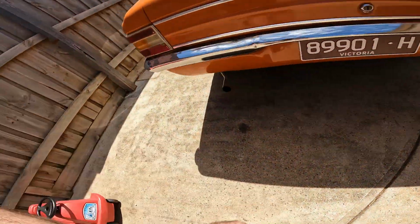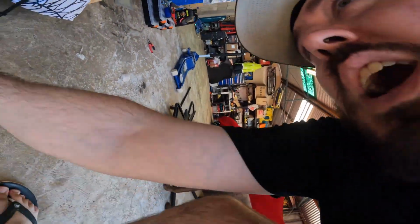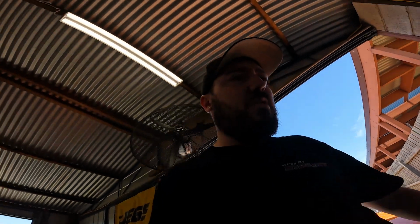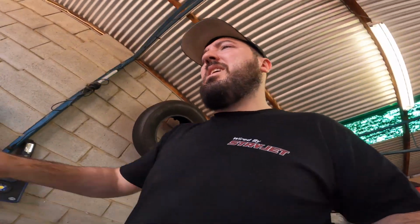What's that? Actually, that knock may cause an issue. I'm gonna fix it up. Let's fix it up. So the exhaust at the back, I don't know why, but it's sort of touching on the body. I heard it before. I did give it a bit of a bend last time, but now I am going to get the big bar. Screwdriver should be alright. And I'm just gonna push it in. Whereabouts was it touching again? Oh yeah, there we go.